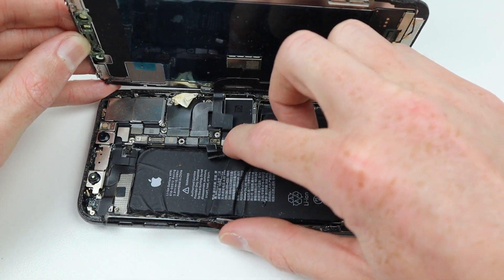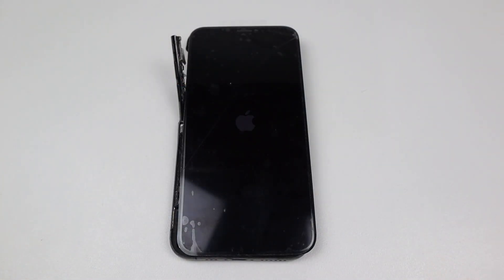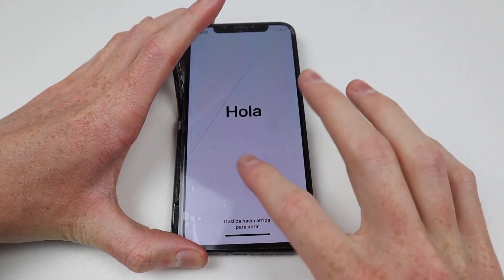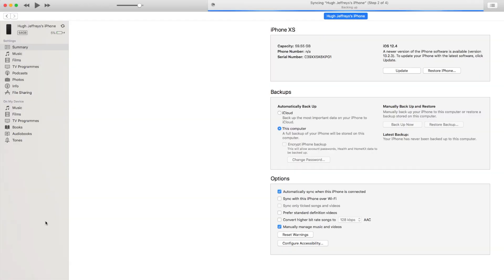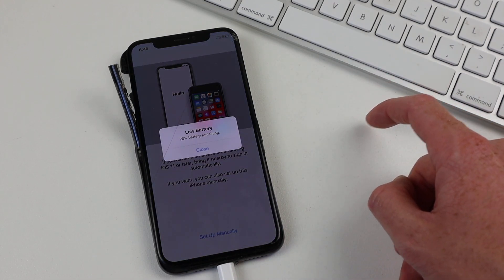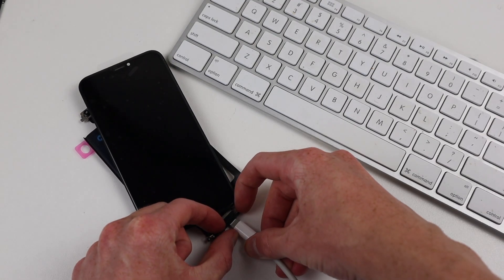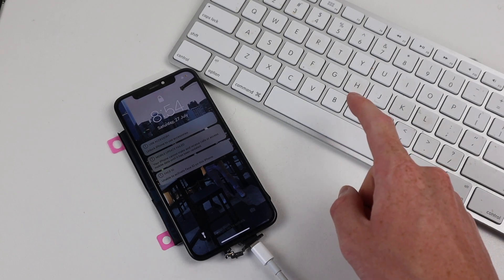It's now time to test this second phone. I'll connect up a test display and reconnect the battery. Closing up the display, I pressed and held the power button and it appeared with the Apple logo. It booted up to the hello screen and had obviously been factory reset. Unfortunately, just like our other iPhone XS, the touch isn't working. In iTunes, I was able to set up the phone and it appears as a 64GB unit on iOS 12.4. So what's going on? Why aren't any of the touchscreens working on these iPhone XS phones? It's definitely not my display — connecting up a USB keyboard, the phone is actually alive underneath. While I'm able to unlock the phone using the keyboard, I can't proceed any further in the setup. And on the other iPhone, the keyboard does nothing as Apple's iOS blocks USB accessories after a restart.